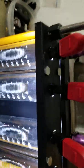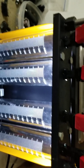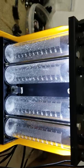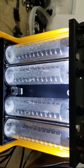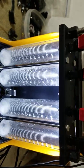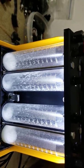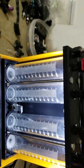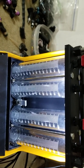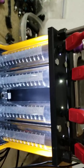Next we'll do a shifting-speed test, which simulates a downshift or upshift — the injectors rapidly change speed. The point is to make sure there's no delay in the commanded duty cycle; you want all the injectors shifting to the new higher or lower speed at exactly the same time. That simulates an up- or downshift.